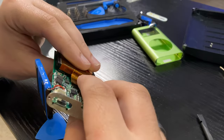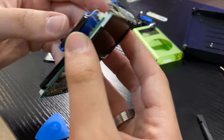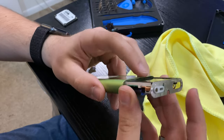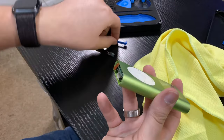Plug the compact flash card right in. Now we go in reverse: seat the compact flash card on the ribbon cable, then press the ribbon cable back onto the board — be sure to line it up before pressing. The last thing you want is to damage any plastic or silicon components on this board, because if you screw anything up here you've got a paperweight. I didn't use any of the tape or rubberized bits — I just let it run naked inside the case. Once the battery's back in and everything's lined up, make it as narrow and flat as possible, line it up with the top of the case, and slide it right back in. Be careful of the small piece on the board that is part of the controller system for the click wheel — if you damage that, the click wheel freaks out.